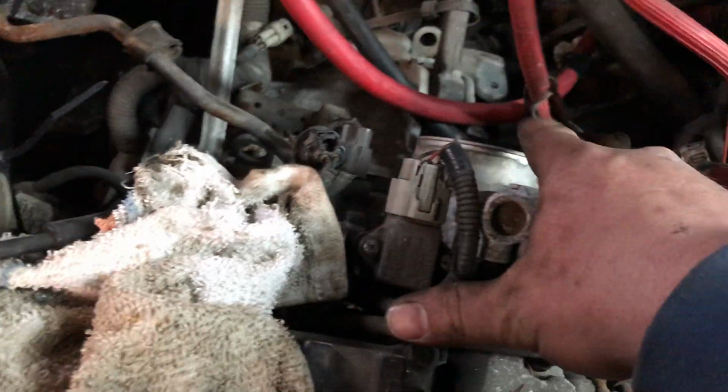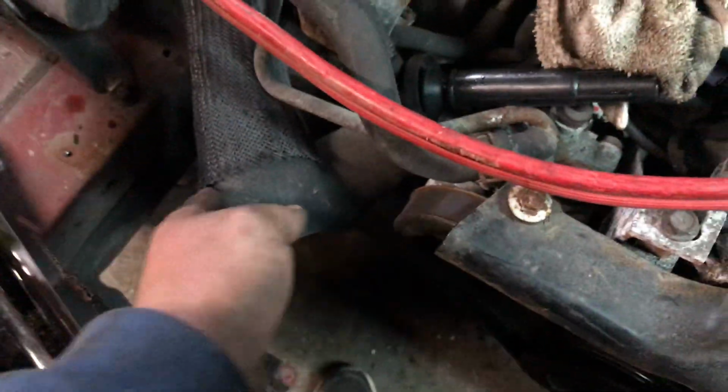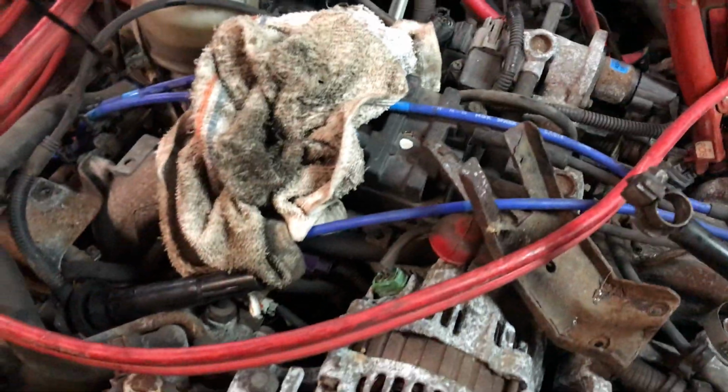What's nice is there used to be a big air box. You take that air box out of here. I'm going to put a 90 on here, I think, over this way with a little tiny filter. It doesn't have to be anything special, just so it's out of the way. Then maybe put a piece of rubber around it from the top side, so if the radiator hose over here does blow, it won't suck it all right in the motor, because it'll essentially be sucking air from back there. I know it's still going to be sucking hot air, but there's nothing you can really do about it.